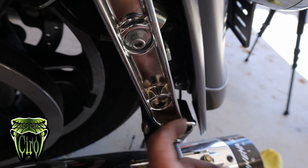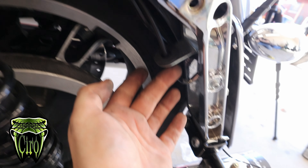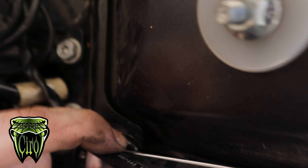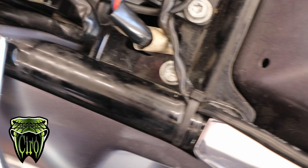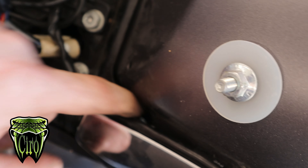On the left side of your bike, you'll notice some wires that come out from the fender. We're going to take this wire and follow it up — it comes up in here, runs up under the fender strut, comes out behind the strut, and then under the seat area to hook it up. Make sure you go up under the fender and secure the new wire to the other wires down there, making sure it's out of the way of your tire and any moving parts. I'll crawl under there and zip tie all that up. It managed to fit inside the factory clips, and I ran it down under this plate and it came out right here, which was really convenient — I didn't have to risk getting it pinched under the seat.